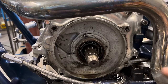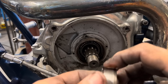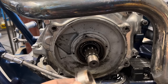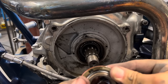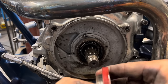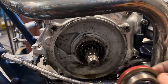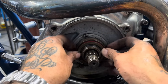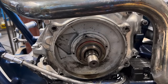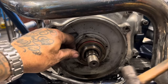Okay, I'm just gonna take some of the oil that's come out of that engine and lubricate the sprocket shaft spacer. I'll put the seal over the spacer. And it's a good fit. Hopefully this solves my problem. I don't see any nicks or anything inside the seal boss that is causing it to leak. So the assumption is that the seal was just bad. It was probably torn when it was put on. Somebody was being careless. Like I said, that was done over 20 years ago.